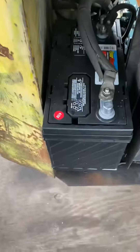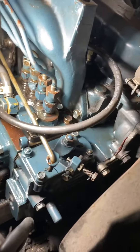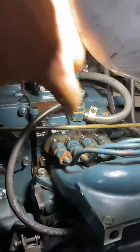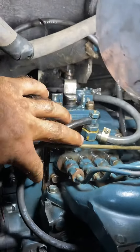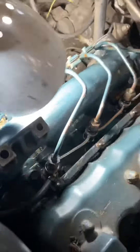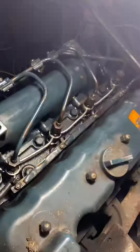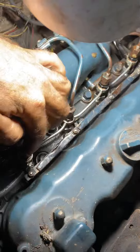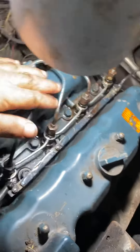This is the new battery and we have the fuel pump rebuild. We've got a little bit of leakage going here but I think we're gonna get it started. We've cleaned the fuel pump and we bled all the lines — we bled it here, we bled it here, we cracked each injector one at a time and bled those lines. Looks like we got a little bit of fuel leak, and it feels like it wants to fire.